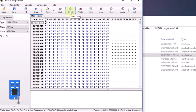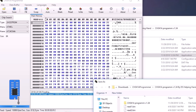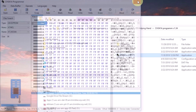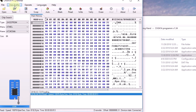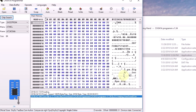First, what you need to do is read. After you read it, save it as read1.bin. I'm going to do it five times — many, many times — to make sure it reads. Right now it read wrong, so the USB is not good. Unplug and plug it back in, then read again. Save this one again. Be very careful dealing with these. Always read first — never erase or do anything like that. Now we're done; we did it six times.